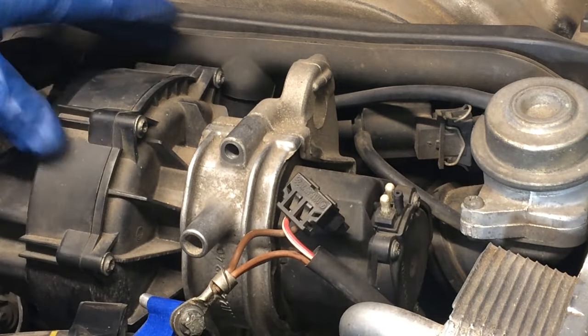If you're not having a problem down there on the hose, leave that hose in place. If you're just trying to mitigate a break up here — which is usually where they break because of the little curve — use the fitting solution and leave that old stretch of hose in there until you absolutely must deal with it. But if you do want to replace another hose while you're in here, you can do this one — I obviously replaced this at some point because it looks brand new. This looks like also a 3.5 millimeter, so all of these stretches are around about a foot or so. If you've got a meter of 3.5 millimeter hose, you could replace this and those two lines we did.